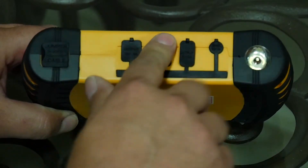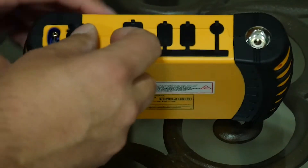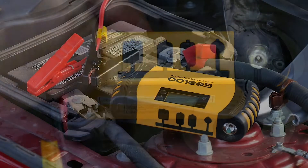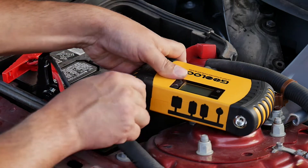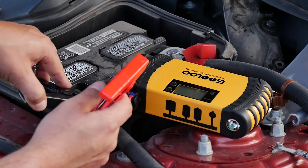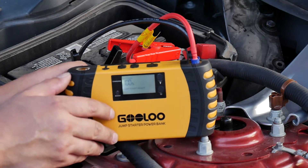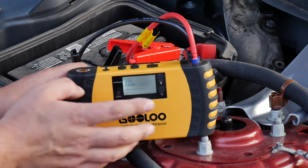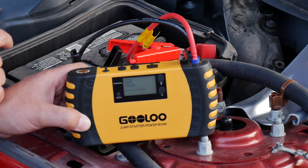Now it's very important to understand you need to make sure this is fully charged before you use it guys. So go ahead and plug it in and charge it up before you try boosting anything. This is where your booster cables will go — it's pretty simple, self-explanatory, they plug right in there. Peel back this rubber cover and go ahead and plug in your booster cables like so. You're going to want black to black and red to red. At this point the LCD screen illuminates — battery 100%, jump start ready. Go ahead and push this boost button right here. You'll feel the click of a relay and at this point you have a thousand cranking amps peak available to your battery to jump start your car.